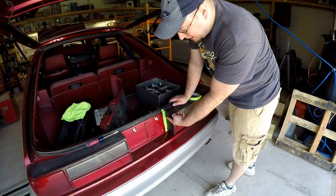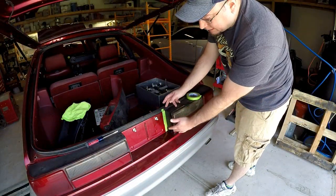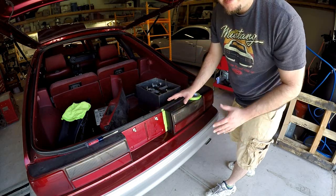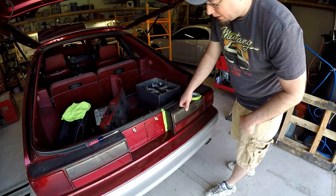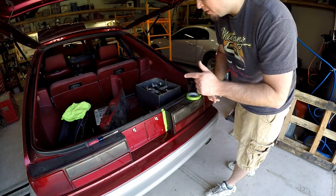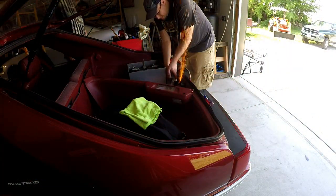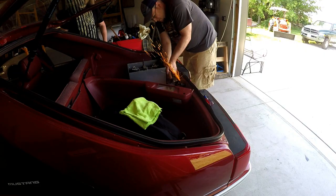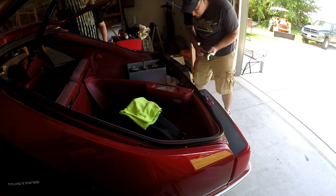We've got our hole marked here. The way I laid the tape down at first was to make sure the tail light and the license plate were there so we know it's not going to interfere with either one — right here it's going to work out. We do have to do a little modification: I'm cutting away some metal that's interfering where the switch will go. If you reference this picture, I had to cut out that metal, so you may need to do so if you're using the switch.